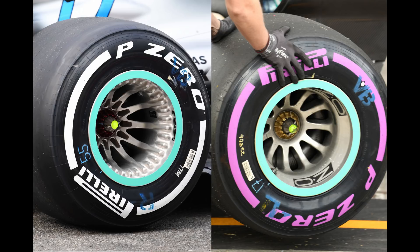This has been an issue for Mercedes for many years, and we've seen them deploy several solutions down the years to try and help manage rear tyre temperatures, so it's no shock to see that they've tried something different here. There are two temperatures to consider when it comes to tyres: the core temperature, which is the temperature of the gas mixture inside the tyre, and the tread temperature, which is affected by the tyre sliding across the track surface. In order to get the best from the tyre, there is a temperature sweet spot between both of these — the holy grail as it were — and one that gives the best performance over the course of one lap or a stint.